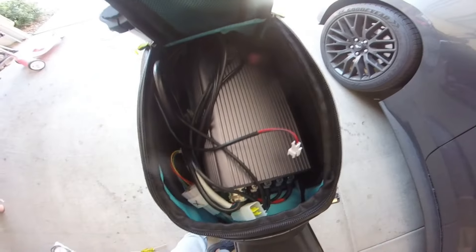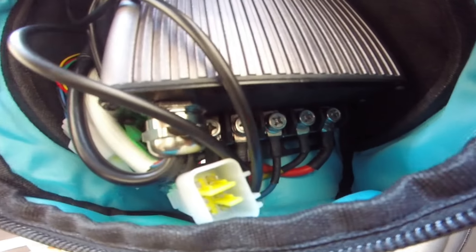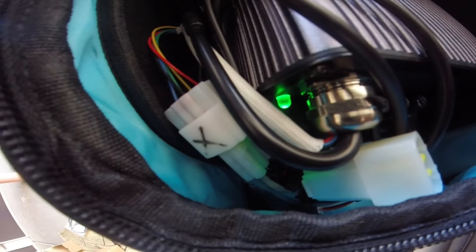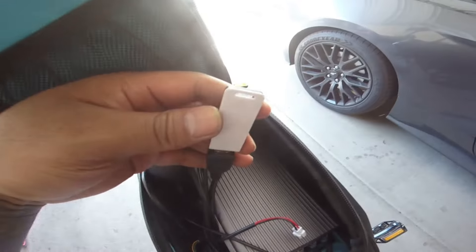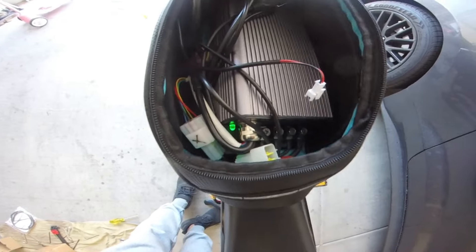Essentially this is where the controller is at. You connect the hall wires — you're going to have yellow, blue, and green. If you know how to match colors, you'll be fine. You have two hall sensors; I marked one with an X just to keep track, because I've heard that you can have one that's messed up. So at least I have the X one marked. You got your Bluetooth dongle — Sal from E Street e-bikes recommended to keep it in, so keeping it in. As far as the parameters, everything is all set up.